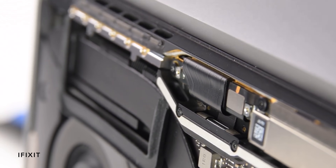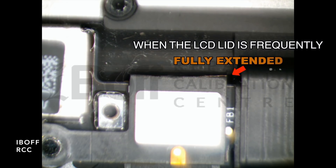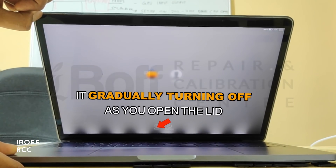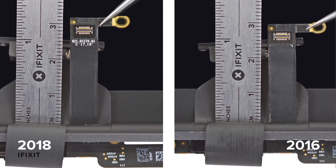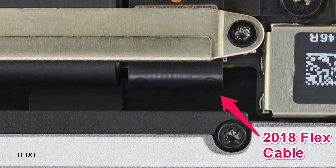Another issue that's popped up more recently is the display cable. The 2016 and 2017 MacBook Pros have a pair of very thin, delicate cables that connect the screen to the chassis. Over time, as people bend the screen back and forth, it can cause issues — it's something called stage lighting, where the backlight has problems and eventually the backlighting can fail completely. Apple supposedly attempted to fix this on the 2018 models by extending the cable, as iFixit uncovered. But they wouldn't have had to do this if they had gone with a thicker chassis.